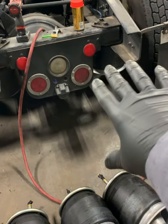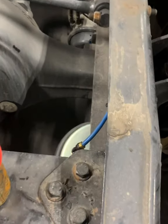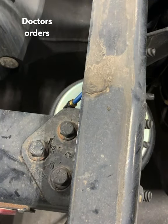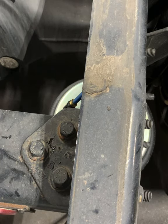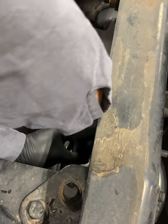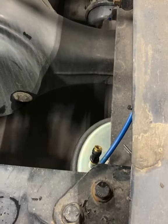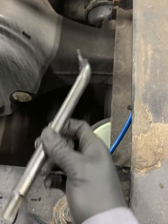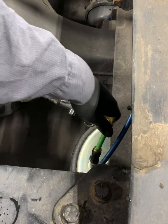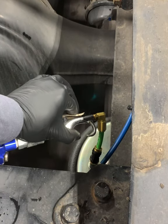Alright, let's get to work. That one's already done, so now we gotta do this one, that one, and that one. Right off the bat we're gonna get that airline off. Disconnect that airline. Sometimes these are real fighters — when they are, I like to use my airline disconnect tool, which has either side to use. Just slide it in there, pull it out, it's good to go. Let me get my gun set up, make it nice and easy, get some air to it and watch the magic happen.